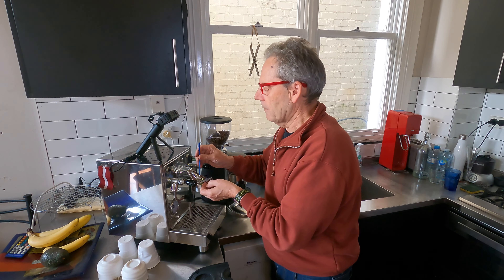Alright, let's put this back together. This had to go back in like that. I've got one more thing to do — this little screen is looking pretty dirty right now. You can sort of see that a lot of the holes are blocked. Once I clean that up, the holes should be more clear. A lot of the coffee granules and oils have got in between the little fine screen and this metal plate behind it, and to clean that out is almost impossible — so I just have to get a replacement screen.